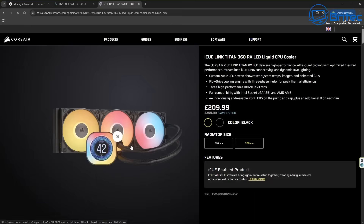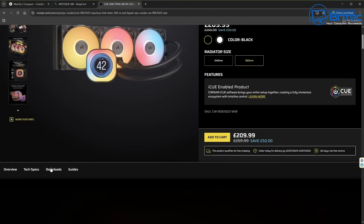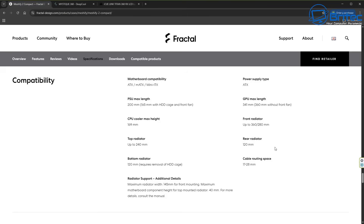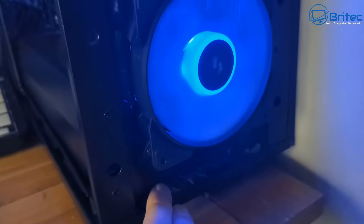You need to make sure the GPU is going to fit if you're going to put a radiator in. Let's head over to Corsair's website and take a look at their 360mm all-in-one liquid cooler. They give you the specifications right down here — click on it and it will tell you the full length of that radiator. It says 396mm — that is the product length. If you go down to the radiator dimensions it tells you 396mm, 120mm, and 27mm. So 396mm is the amount of space you're going to need in that front. But the case website says front mounted up to 360mm, so you just might not have enough space if you pick one of the larger radiators.